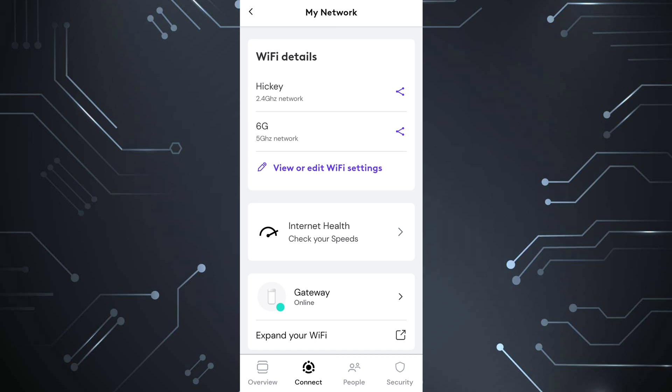Those new devices that you needed to connect will also connect inside of that mesh network with no problem. If it did not split, if it did not save, restart the router — unplug it for 20 seconds, plug it back in — and see if it worked, or just close the app and open the app again. Sometimes if you just wait 30 seconds to a minute, the process will take place. Sometimes it takes a minute for it to actually load in the system and get it all set up. So don't panic — restart, close the app, open it back up. It should work perfectly.